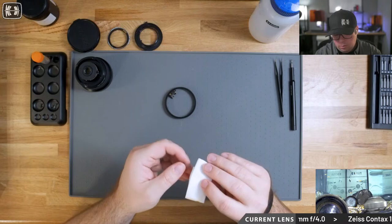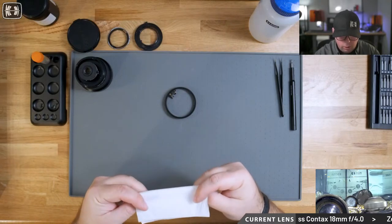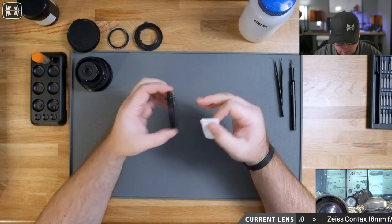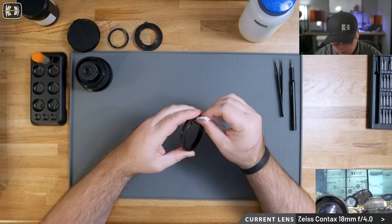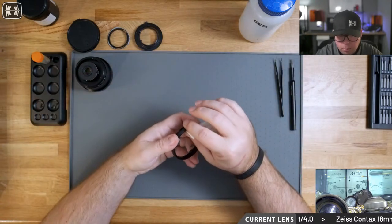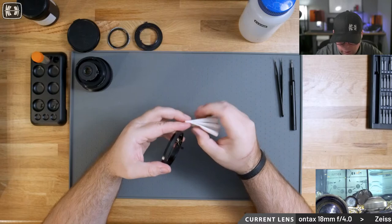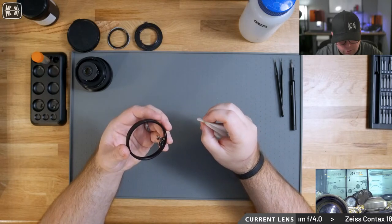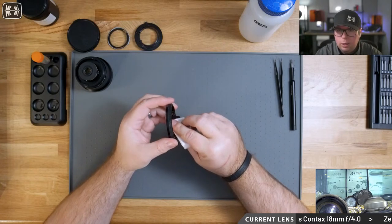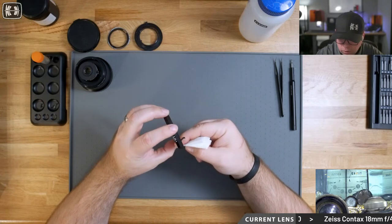can't hurt. We did a pretty thorough study of UV exposure when COVID first came about because everyone was trying to use whatever means they could to kill the virus, and a couple of different companies were exploring UV tools to protect their inventory, allowing people to touch lenses and hand off lenses and not be contaminated, so to speak. So we did a pretty in-depth study of intense exposure to UV light, and from our research it's not going to hurt the glass, but there are other materials in a lens that it could, I wouldn't say hurt, but hasten the aging. So if a lens has plastic components, it's not going to do any favors in that regard.